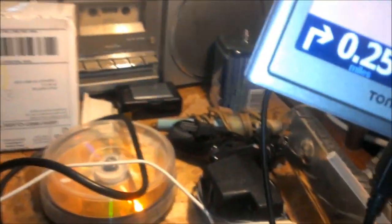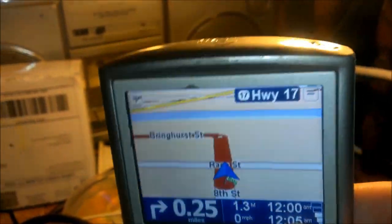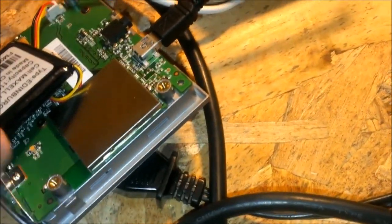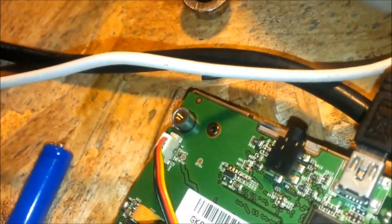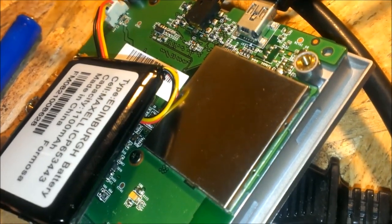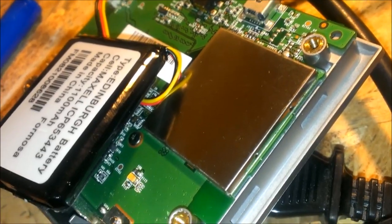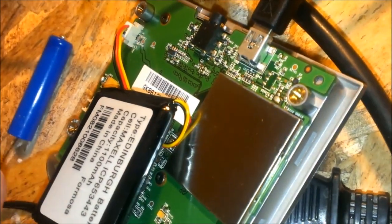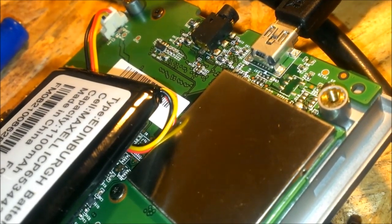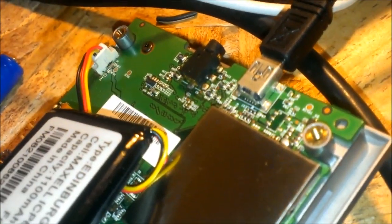I had to jump it again, but I didn't really need to. What's actually wrong with it is that the battery went down to 0%, and usually when they do that they won't take a charge again because the circuitry in here prevents charging a dead battery. It's just that some of these batteries they gas a little bit, and the circuitry thinks the battery's bad when it's at 0% — it thinks it's been shorted. That's why it doesn't take a charge again. But if you leave it for months at a time without being charged or used, the battery runs down past the percentage this thing allows and it won't ever take a charge again.